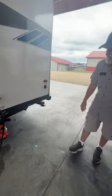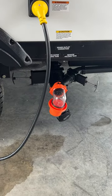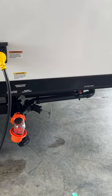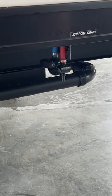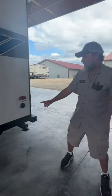At the dump station: the three-inch valve in the front is your toilet water. The two-inch gray valve in the back will be your kitchen sink, bathroom sink, and shower water. You also have two low water drain points — the blue is the cold side of the water system, the red is the hot side. They'll be used for winterizing and de-winterizing the unit.